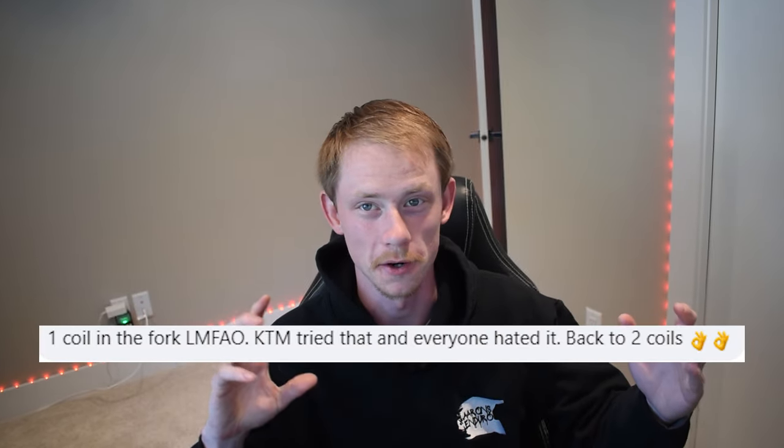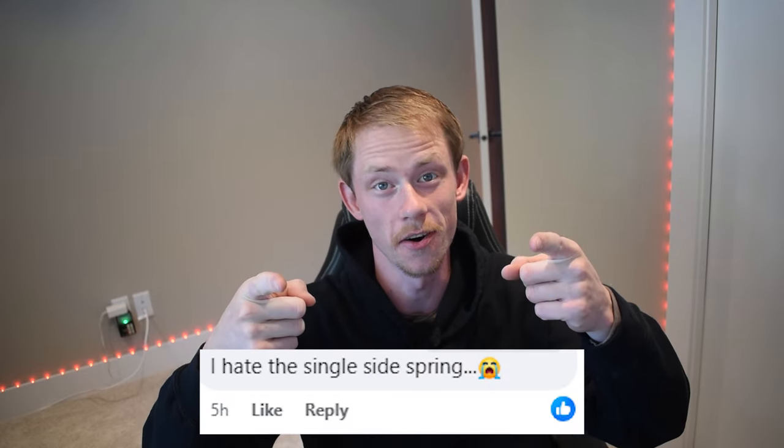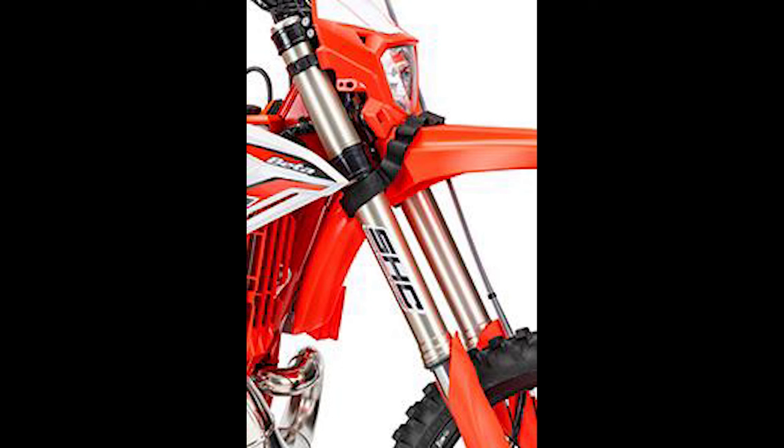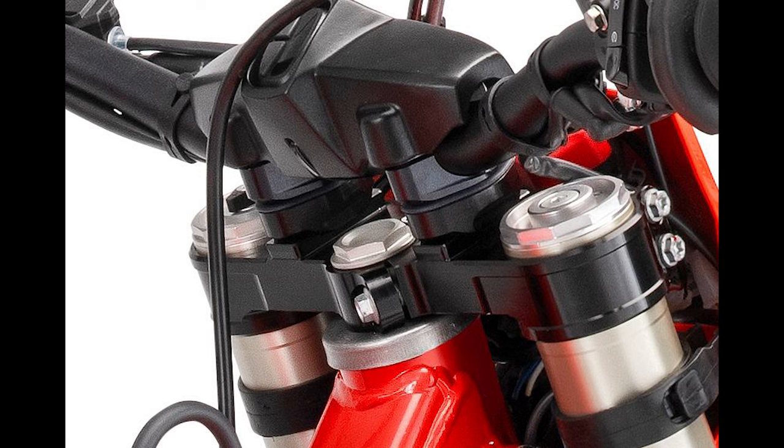Now this first piece is kind of divisive — people are not so stoked from what I'm reading through the forums. I made a post on Facebook and let you guys tell me what you thought about the new fork system. Here's the new fork: the all new ZF SHC front fork. It is lighter weight than earlier standard RR models, designed using one spring on the right side tube that includes a preload adjuster, while all the fork's compression and rebound damping is handled in the left side.